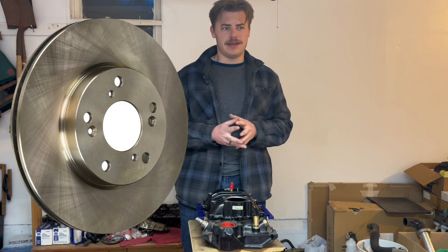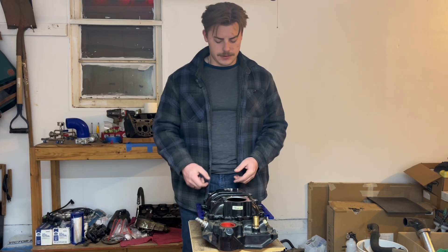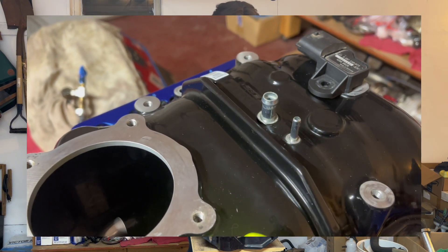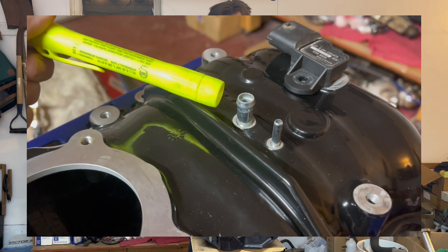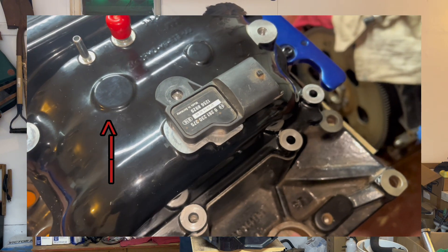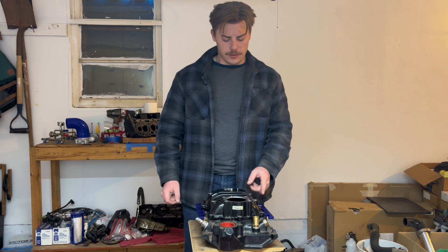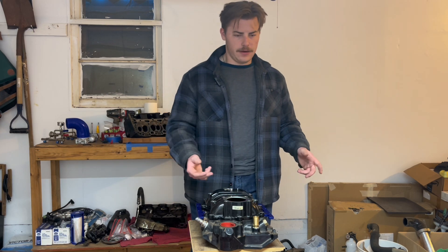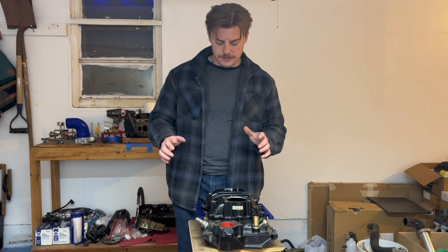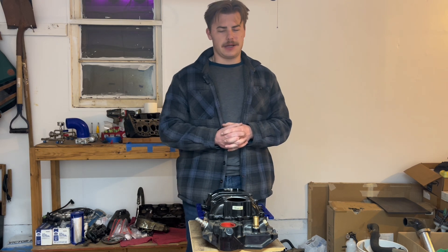There are safety concerns like brakes and cooling that you should figure out. First, let's tackle brakes and boost reference. This comes with two boost line references: the first being an eighth-inch fitting, and the second being a three-eighths fitting. Your three-eighths is technically too small for your brake booster, so what you really should do is drill one of these circles — preferably the larger one — out for a half-inch NPT fitting and hook up your brake booster there. Run your regular vacuum reference off the eighth-inch fitting, and then figure out what to do with the three-eighths — you can either plug it or utilize it for a different boost reference. Or if you're feeling squirrely, you can use that three-eighths fitting for your brake booster, which in theory should be fine, but for legal reasons I cannot recommend that.